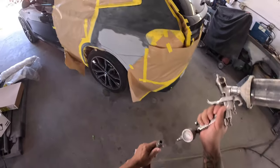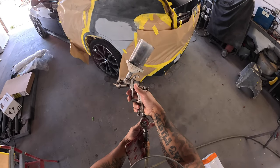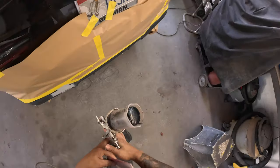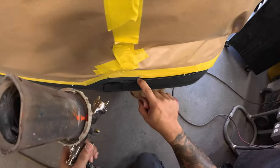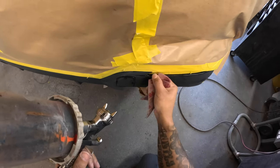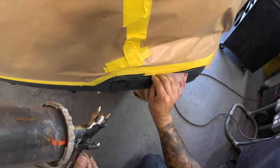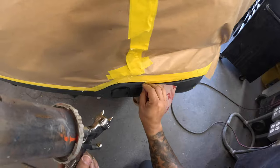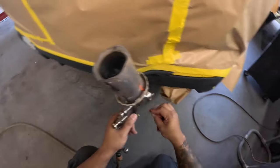Back in the lab today we have a BMW X3. It's a quarter and rear bumper. The rear bumper is a two-tone — bottom color is solid black, and up above it is metallic black. Getting ready to spray it here, and I noticed that my prepper left a few areas that were still shiny.